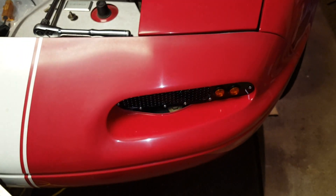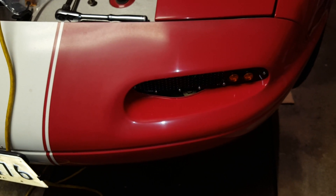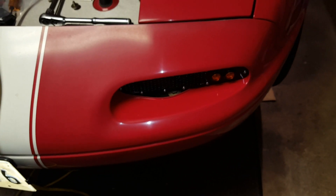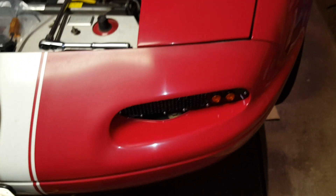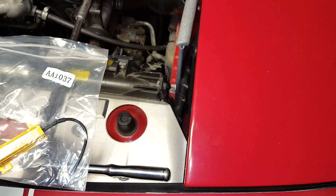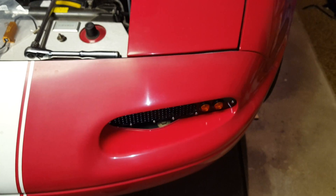I'll include a link in the description below as to where I got them from. It came from California, so if you're on the left coast it'll probably arrive relatively soon. It took about a week to ship, but they were like $7 shipped for two of them. You'll need one of these for each LED turn signal that you replace — each one that would normally be incandescent that you're replacing with an LED. These came in a two-pack: a 50-watt, 6-ohm resistor.